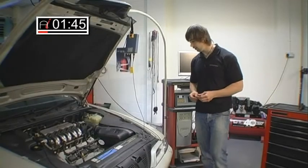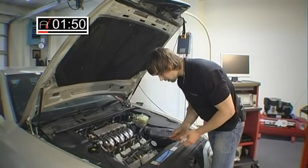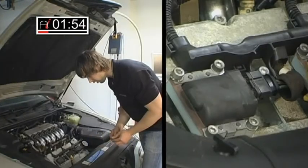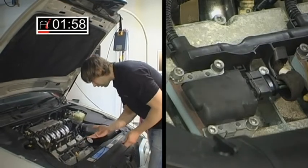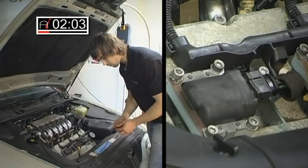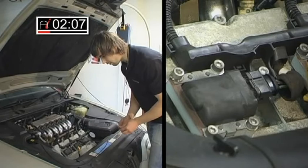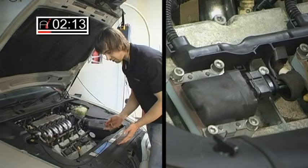As you can see, we've got three direct coil-and-plugs here. The main reason for doing this is because we can't access the secondary part of the coil — it's bolted down and we can't see the condition inside. But this is very useful to do before removing the plug, to assess what's going on beneath. This is non-intrusive testing, dead simple and quick, giving us a general idea of the health of the car.